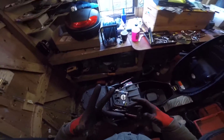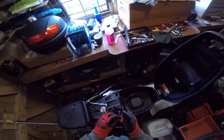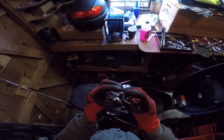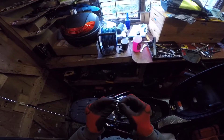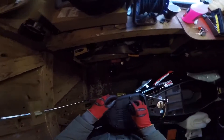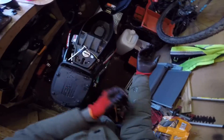The variator ring - I've already taken mine out so I'm not going to dismantle the side of the engine casing. The variator ring is located down the left side where the kickstand is. You basically take this black casing off, your variator is on this side here, you take that piece off, the ring is inside, and you put it all back together. This is also where the belt goes round.